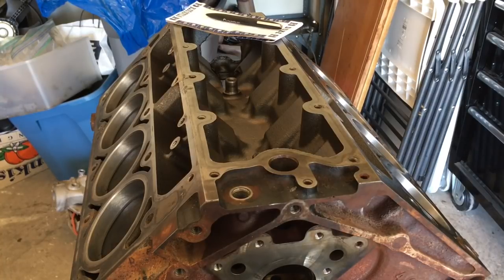I was doing a little research online. Piston ring manufacturers say that under 15 pounds or less of boost, you're only supposed to use a multiplier of 5.5 thousandths — so .0055 per inch of cylinder bore. This is a 3.78 bore engine times 5.5 thousandths per inch of cylinder bore — that's about 21 thousandths top ring gap. Another manufacturer says use a multiplier of 6 thousandths per bore, which brings you up to 22. I need to do a little more research to see what other people are doing on low boost, daily driven, pump gas street engines, because I absolutely don't want to run into blow-by issues or oil consumption issues from too wide a ring gap.